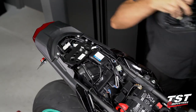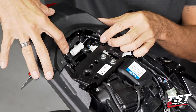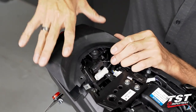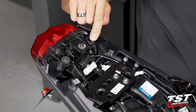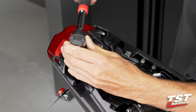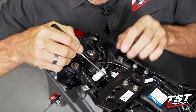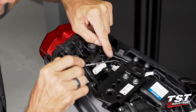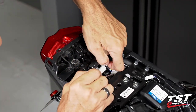I'm going to begin by removing the seat. Then we'll grab a Phillips screwdriver and remove these two fasteners. This panel will need to be rotated up until it makes a little snapping noise, and then pushed towards the rear. This sliding clip engages with this interference window that needs to be cleared out, and we have access here. We will remove these two fasteners using an 8mm socket. I'll grab a small flathead screwdriver to get this connector out of its mating connector — that is our main tail light connection point. I push in on the locking mechanism and withdraw the connector.